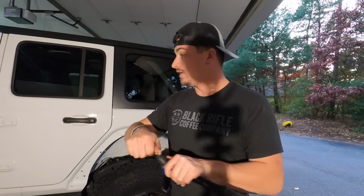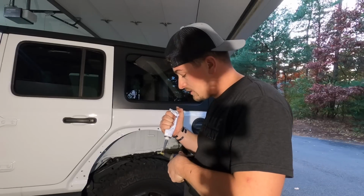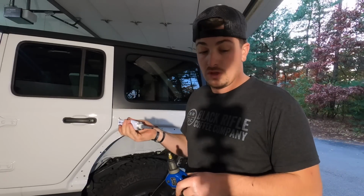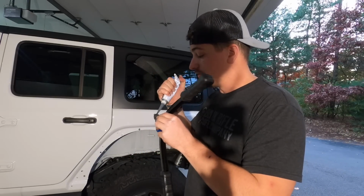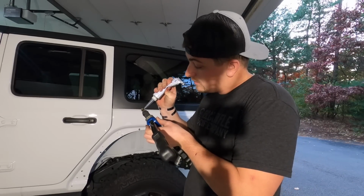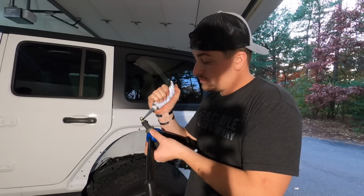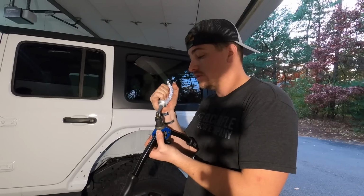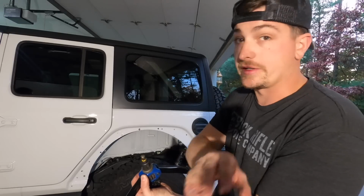No respect. And again, make sure these all crush properly, otherwise you're gonna need to remove it. And removing these is a royal pain in the butt, so make sure you crush them properly. Take your time. That's why I don't necessarily suggest using this tool. If I had a riv nut tool, like the little nut that worked properly right now, I'd use that, but I don't. So make do with what you got, but you can take your time more, make sure you have a more flat crush with the tool, but this does work faster with less effort. So if you're good at using it, by all means, use it. It's a great tool. I'm just not good at it.